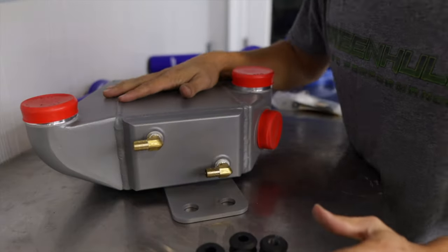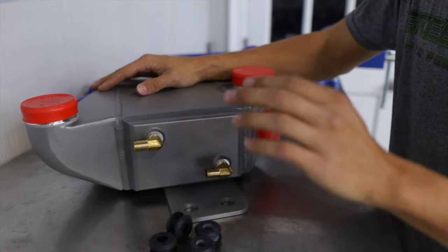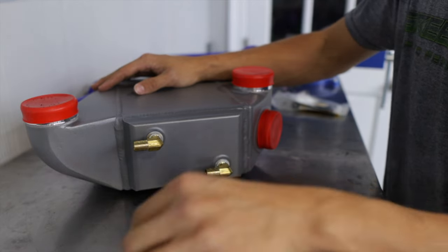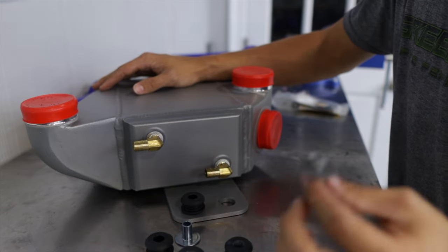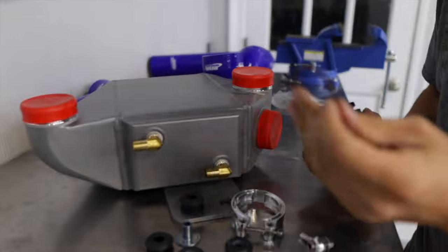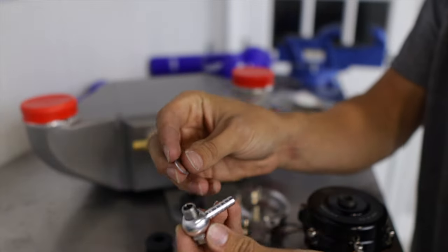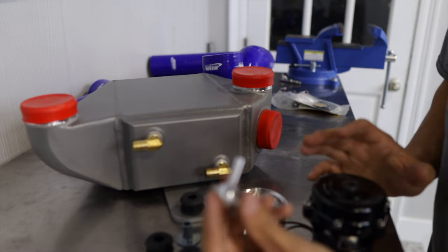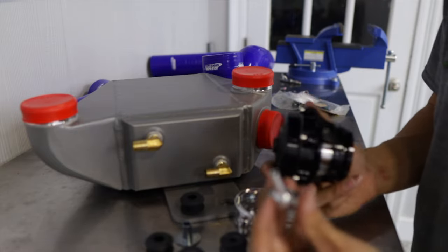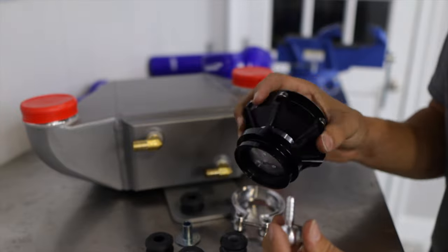There are a couple of things we're going to have to do to this intercooler before putting it in the ski. First, get the old hardware off the factory airbox and put it on the new intercooler — we'll use the same bolts to secure it to the new bracket. These rubber bushings will go through these holes, then come through the back side and finish off with this hardware securing it to the bracket. After that, put the blow-off valve on here using this clamp, and the O-ring goes in place between the two to seal it from outside air. On top of the blow-off valve, a washer goes on each side of this fitting, and this runs to the vacuum line tapped into the intake manifold so the blow-off valve will open and close. I like to put the blow-off valve loosely in place and tighten everything once it's all aligned after it's in the ski, since we might have to twist it back and forth to clear the intake tube.